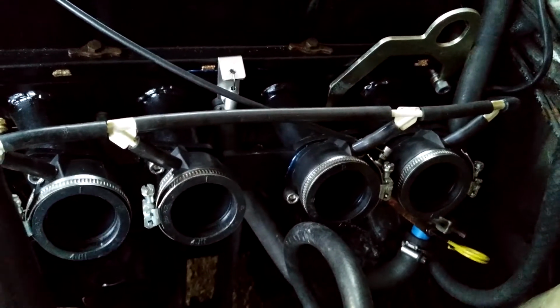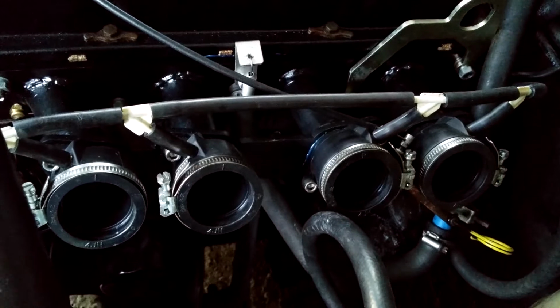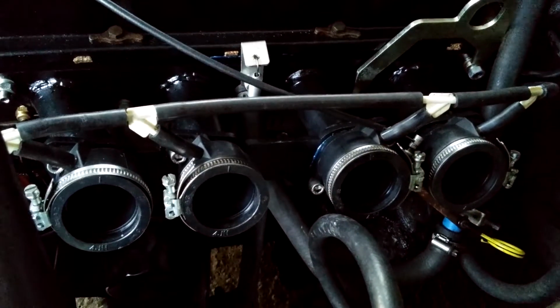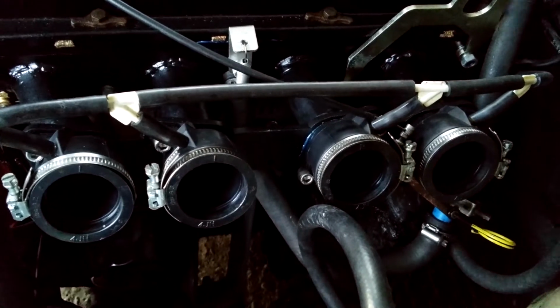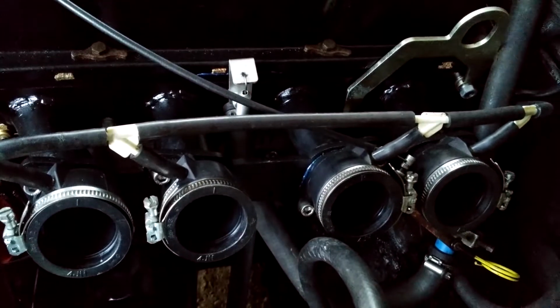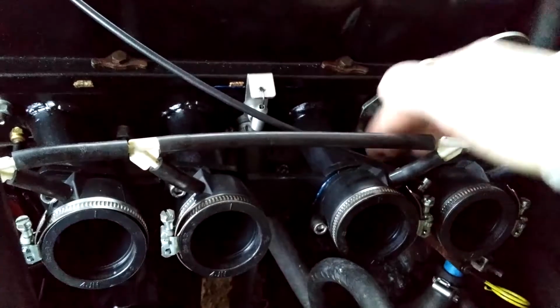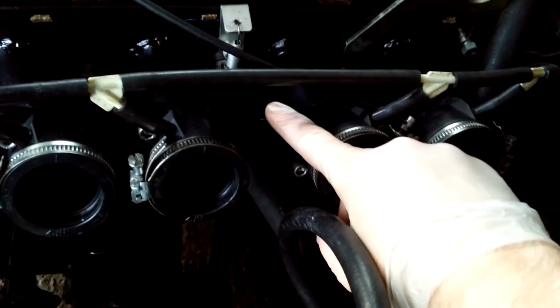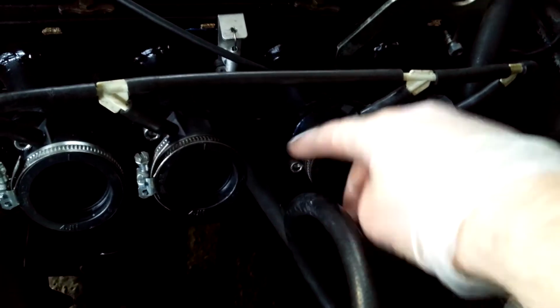My previous manifold wasn't really designed, I just kind of winged it. This one I actually designed. I used a little bit of 3D stuff in SketchUp to figure out some angles I needed to place these 4 runners at. So there's 4 pipes, and I used some design software to create a flange, one long piece.